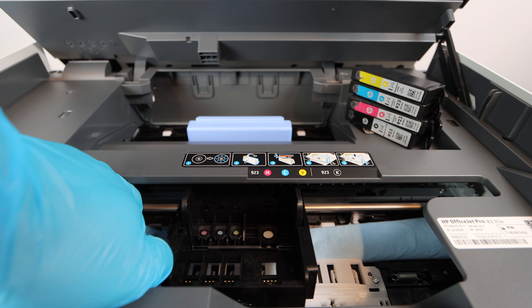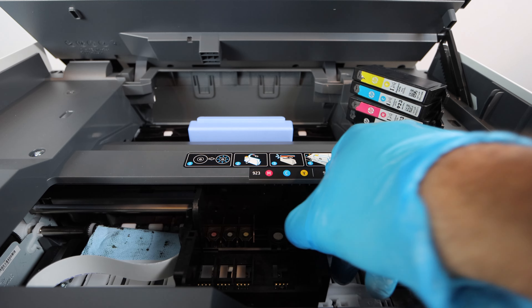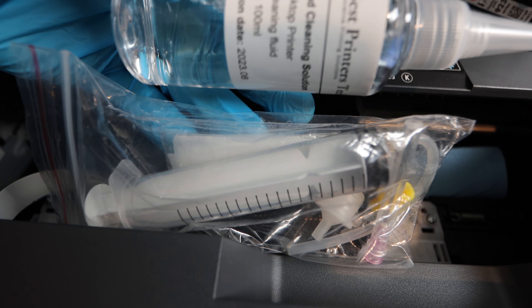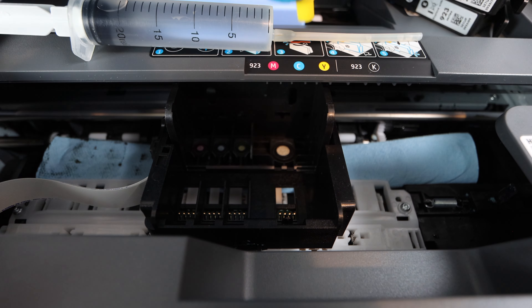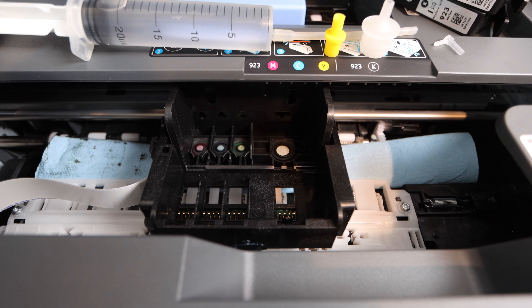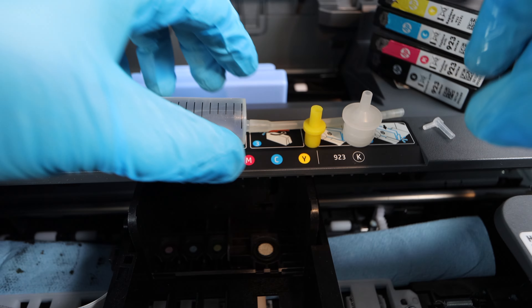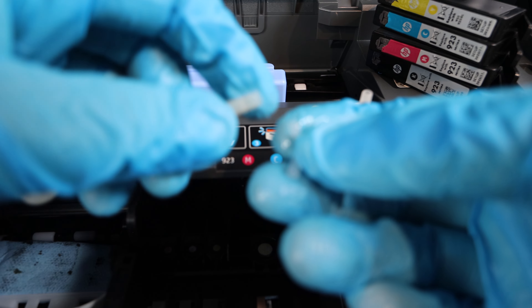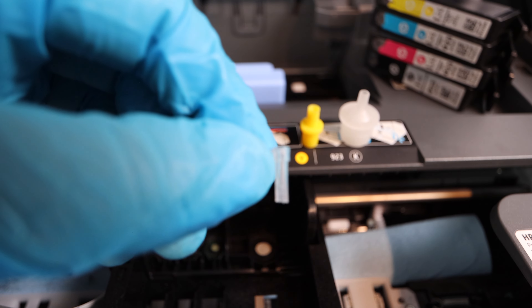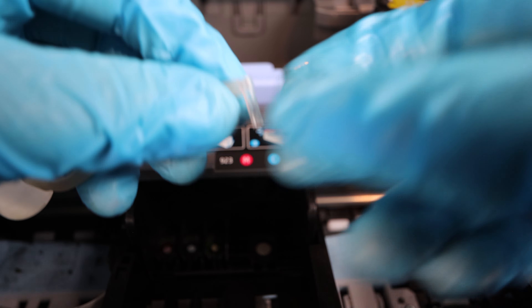One note with the paper towel: while you're doing this cleaning, you can swap it out after every 20 milliliters or so — I recommend doing that, or at least moving it so a different part gets soaked. From the Best Printer's Cleaning Kit, you're going to use three different attachments: the yellow piece, the clear larger piece, and a small L-shaped plastic piece. There are two L-shaped pieces in the kit but you only need one. Attach it to the syringe tubing already attached to the syringe.